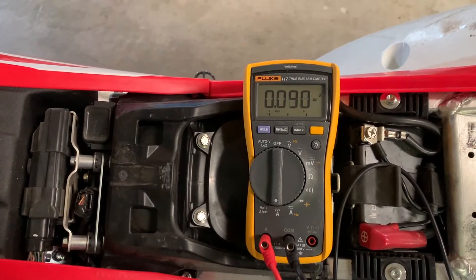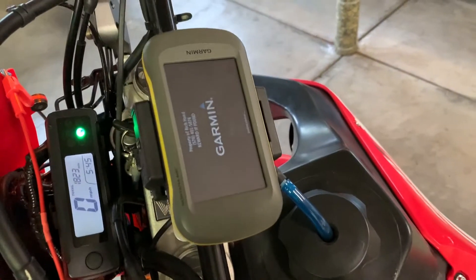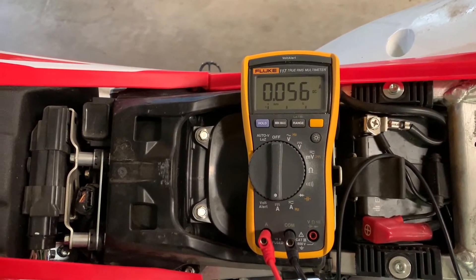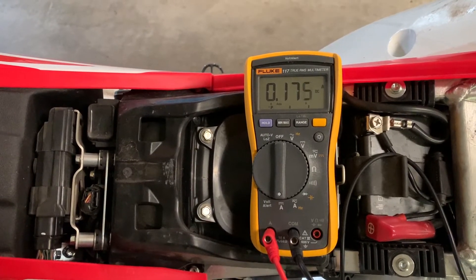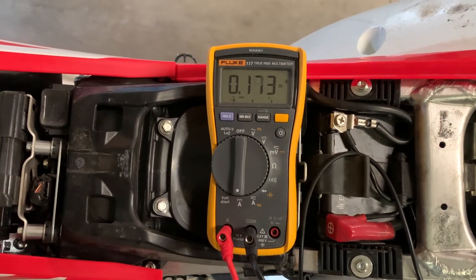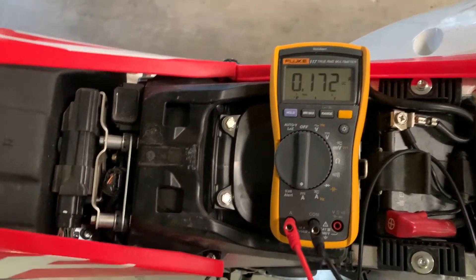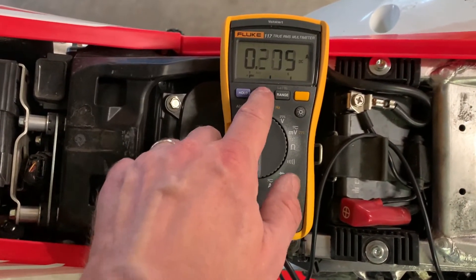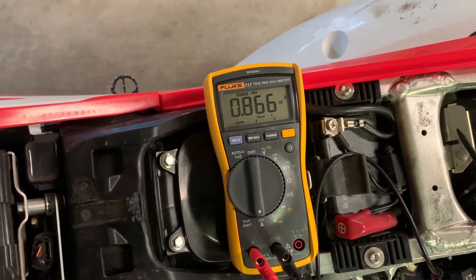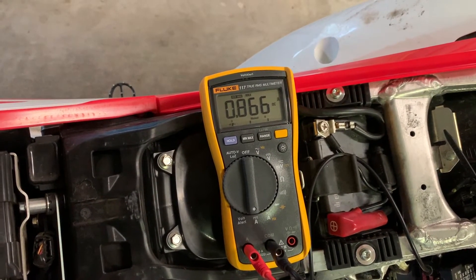GPS is booting. Looks like it's really minimal — might go up a little bit as the illumination turns on. And it did. So that's the GPS up and running — less than 250 milliamps, a really tiny amount of current. Let's do the signals again — put it on max, brake. With the GPS on, illumination on, holding the brake, turn signal on, we're still under one amp.